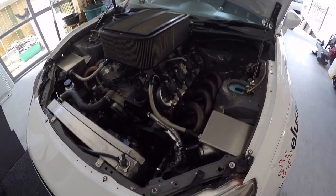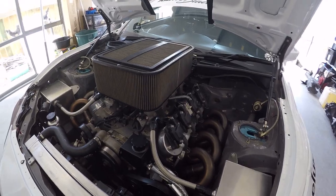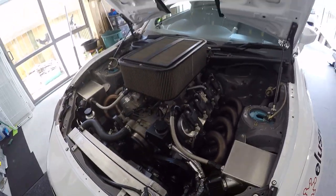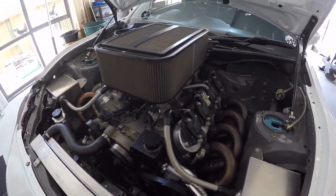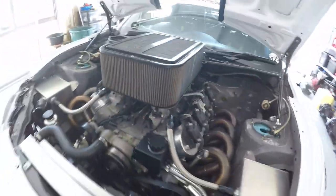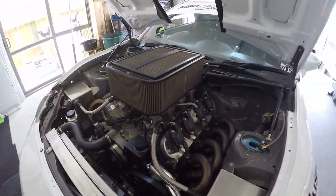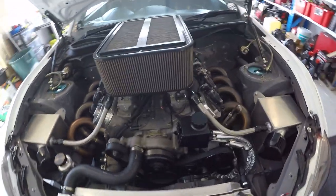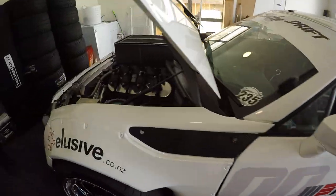It's running about 420 kilowatts at the moment and just under 800 Nm of torque, so it's a bit of a beast. Something quite unique about this motor is obviously the big K&N sprint car filter on top — carbon fibre, fully recleanable and reusable — and it sits on eight individual throttle bodies. It sounds bloody awesome. It also runs through Triple T Engineering's full stainless steel manifold setup, full three-inch stainless steel right to the back just before the wheels.